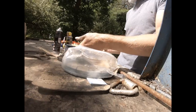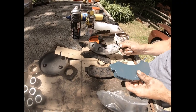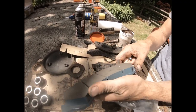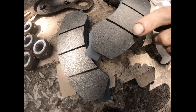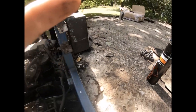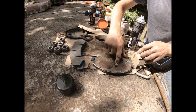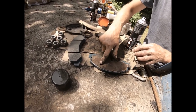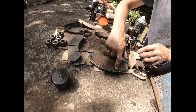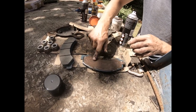So, what have we got? Brake pads look pretty much the same. Just going to zip those over, and you can see they both got the clip on there. So I'm going to place that there, and you can see how much more meat these ones have got on them, which is why we had to push the pistons right back in. This all just allows the caliper and everything to slide against each other without causing a screech. Yeah, well, it stops it making a noise, and you want everything to be going easily.